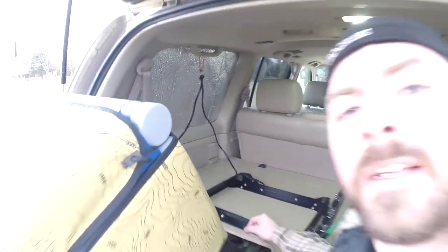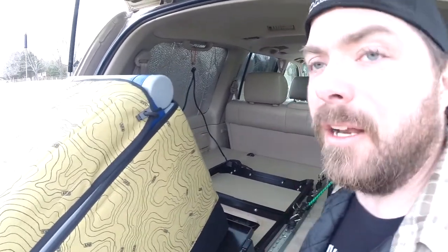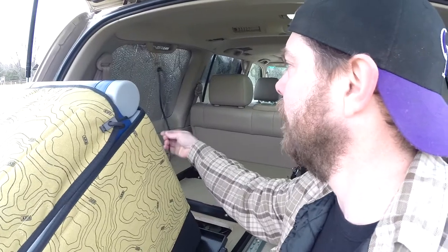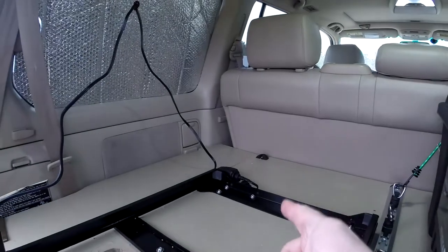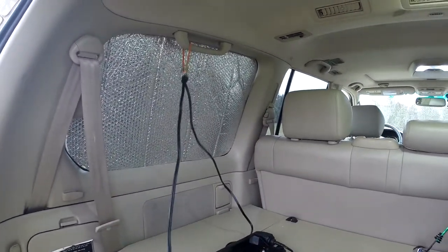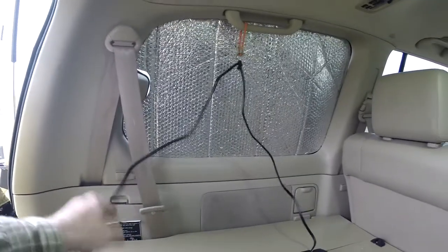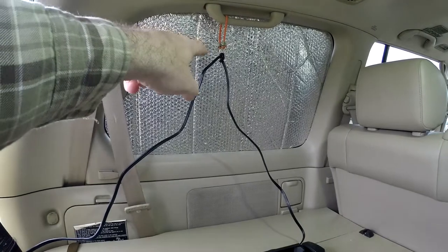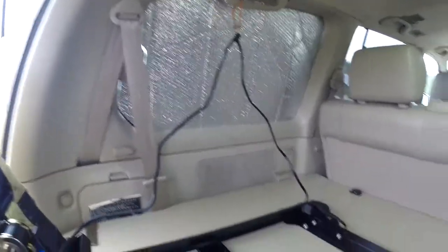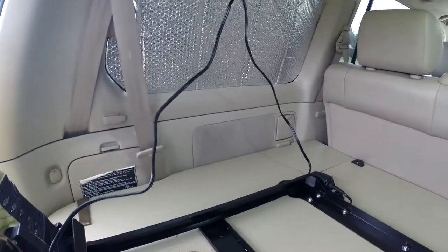One of the biggest questions I had is how I was going to run the power cable. What I noticed on some of the South African and Australian builds is they have a cage built around their fridges, which allows them to pack stuff in and around it. Most of those systems have something built in to bungee the cord to the top in the middle of the cage so it can accordion out. We have our threaded connector back here where the wire plugs in and screws in tight, then routes up to our handle with a little bungee that gives it slack. There is no tension on this wire at all — I tied a knot to get the bungee to the perfect length so there's no tension and it won't hang down and get tangled or pinched in the slide.